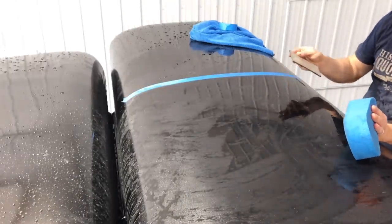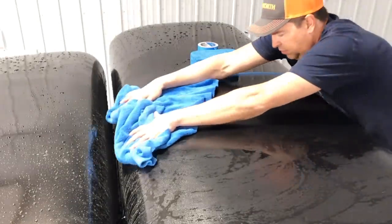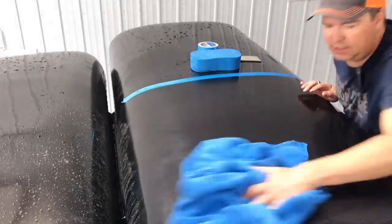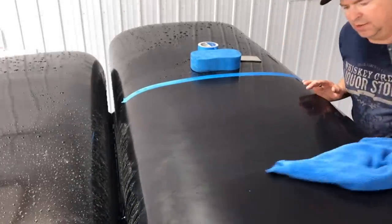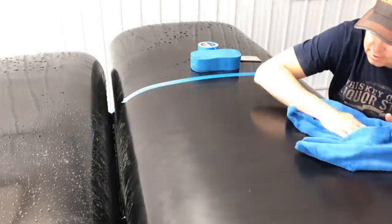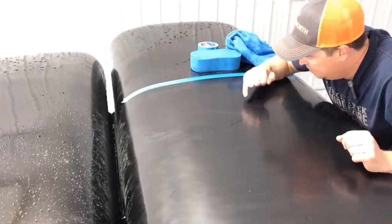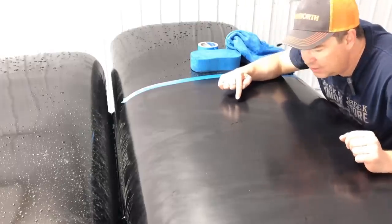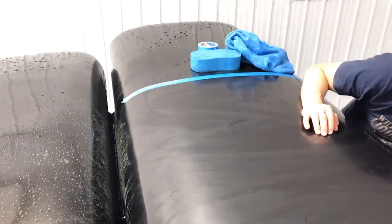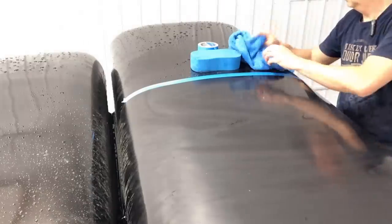At least get some practice up here and see how this process works in real life. So what I'll do is dry this up now and see how it looks. It should look dull, obviously, because we kind of sanded down into the clear layer. Now, this is a single-stage paint, not base clear. So when you dry it, it's obviously dull now, but I can still see it's smooth here — there's still orange peel, but there's less of it. So I think I'll keep sanding on the front half here, but yeah, this should work.